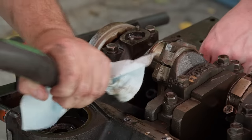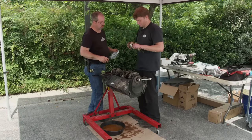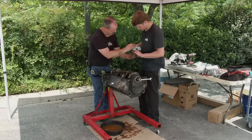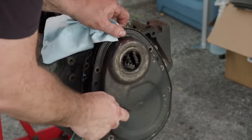That's pretty standard stuff. Do the rings move? Yeah, they still move, which is good — that's a good sign. The important part is the skirt. The skirt is not gouged up, not broken off, and doesn't look collapsed. Gravy. That's not even that bad.